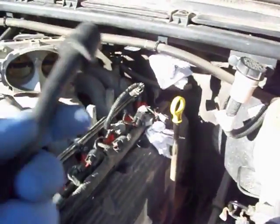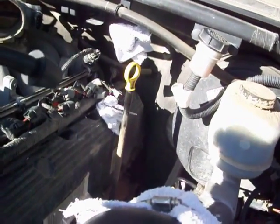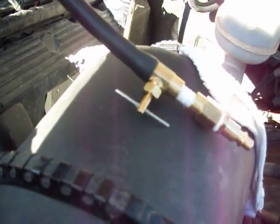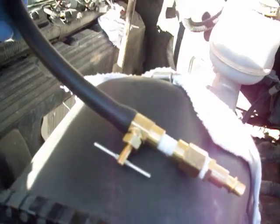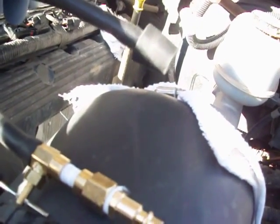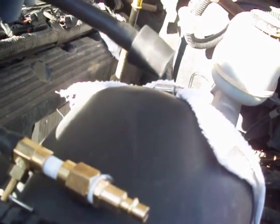The next step is to get the valves closed. With the spark plug out, the cylinder is open from the spark plug well down. I take this rubber stopper, poke it into the top of the spark plug well, hook the other end up to about 20 psi — pretty low pressure — and start feeding air in by opening this little valve. As long as the valves are open, air will escape and the rubber stopper will stay stuck in the spark plug well.